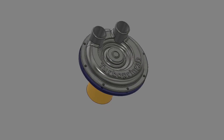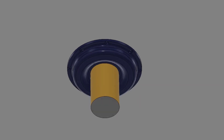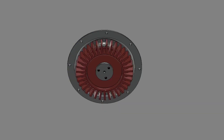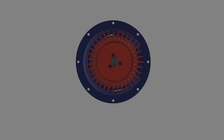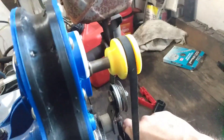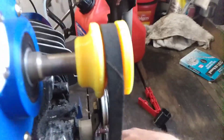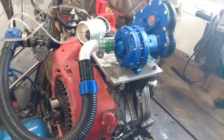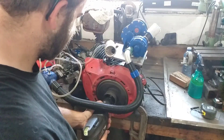The reason I switched from the previous style regen supercharger was potential — I come up to about a 3 PSI limit, and after that the load goes through the roof on the regen turbines and heat builds up a lot, which sort of explains why nobody's built a regen supercharger before. The limitations are just too much; it would work, but I wanted to see what I could get out of this style supercharger. The other problem is that over the winter, some of the shafts or bearings moved and it bound up completely, or something failed.